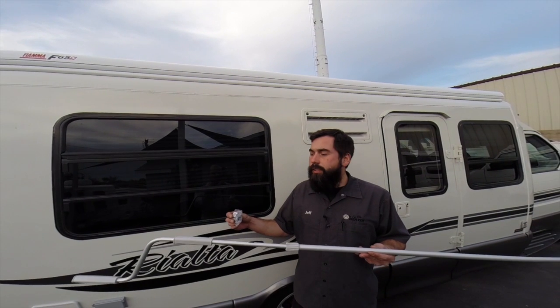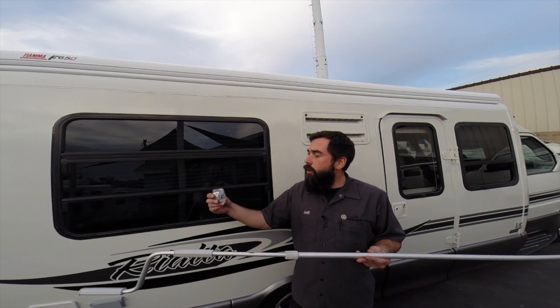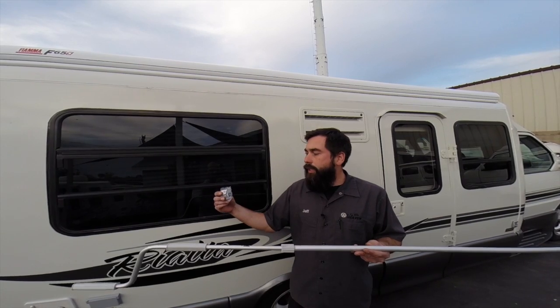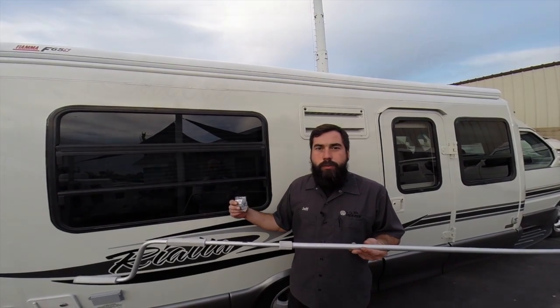The last step of the installation would be to install your crank brackets. Customers have their own idea of where they like to place them, so we leave that up to you. This is Jeff with Rialta Heaven. That concludes the Fiamma F65s installation.